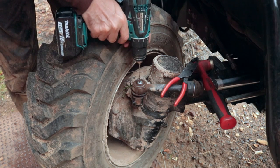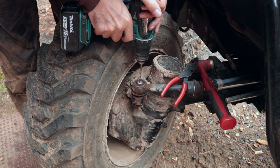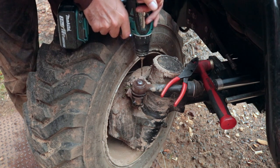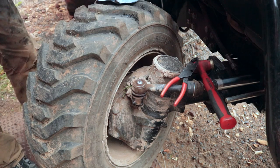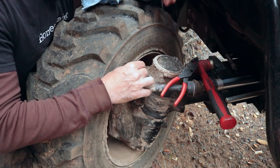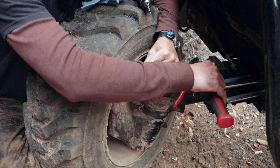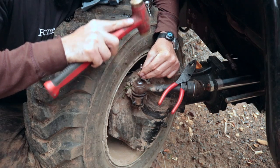We'll push that right in the center and start drilling. Now, that is very bad — what just happened was the drill bit caught the threads and ran the remnants of the grease fitting all the way through the threads, and it threaded out and fell inside the ball joint.